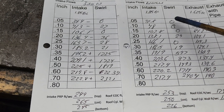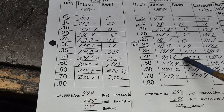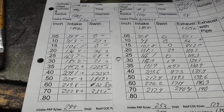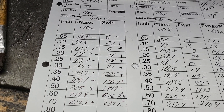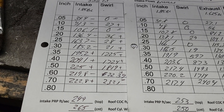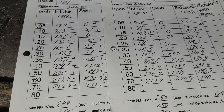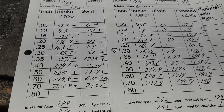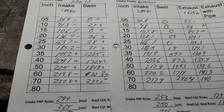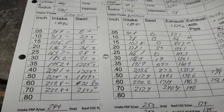Take a look at what happened with our swirl — it went up, went up, went up. Pluses and minuses, equals, plus, equals, plus, plus, plus, plus — one minus all the way at the bottom. So it changed our swirl radically. Does it make that big a difference? Not really, because as soon as we put the intake on it, it takes a lot of that swirl out. So I'm not really sweating it at this point in the development.